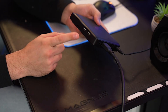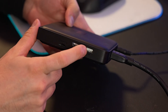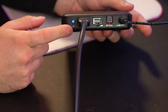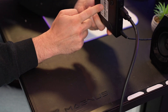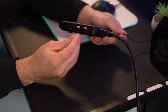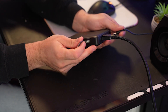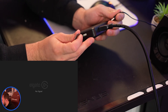If you can't factory reset your device that way because it's frozen, this is where your device's reset switch comes in. On the Kinhank model, the reset switch is right here — you'll see it say 'Reset' with a little circle. On some devices with a different style, it might be inside the AV port or there's a little button underneath. I'm going to show you what to do. I'll unplug it — you'll see my screen go off. You want to hold down that switch; it's a soft push and you'll need something like a bobby pin. Hold it down and while holding it, go ahead and plug in your power source again.